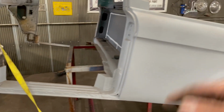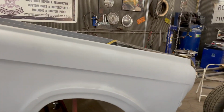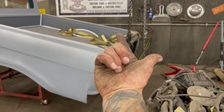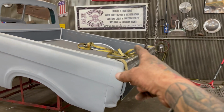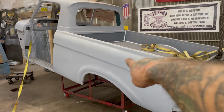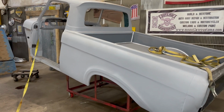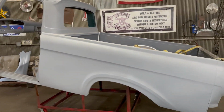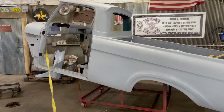And then I want to jack the back part up. I got it latched right through the old hole where the tailgate handle pull would have been. So I'm pulling it up like this, and then I'll weld some brackets up off this dolly to hold it up. That should hold it, and I'll make sure it's safe, of course. Then I'll lock the wheels right where it's at, so I can do the body work and all the welding underneath right here. And I'll put my big jack stands up to hold the body up too, just in case it wants to do anything stupid.